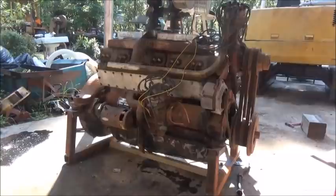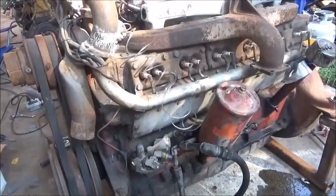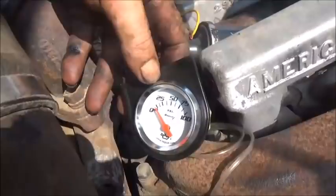I've got to block off the oil pressure port on the other side, or see if I've got a gauge I can put in it. Also I've got to run the oil cooler lines together. Alright folks, the oil lines — I've got them run together. It's not pretty, but it'll work. Put an oil pressure gauge on it. We'll try that out and see. I'm going to try to keep it away from the exhaust so it doesn't burn that plastic line up. I think we're ready for some battery and some power now. We're getting really close.